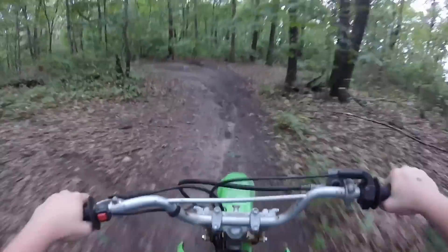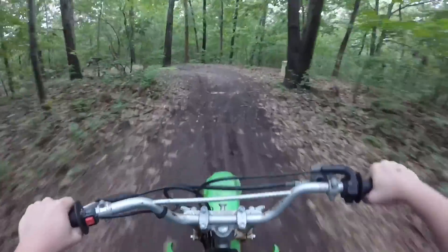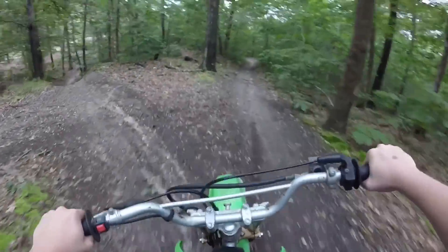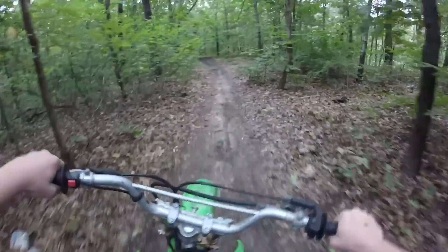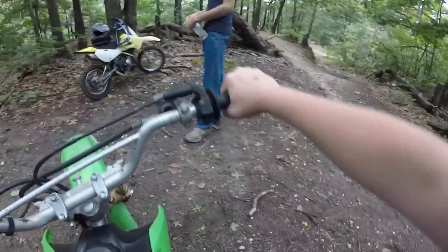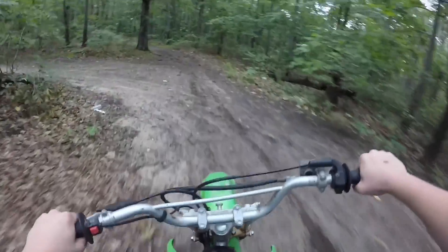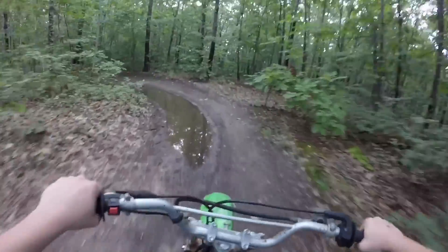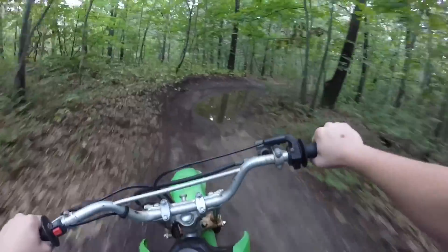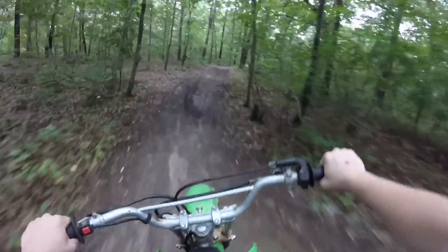These little puddles actually help you get up above the banks, which helps me out a lot since I'm not the best rider. If you guys don't know, this is a 2006 Kawasaki KLX 125 - one of the newest bikes added to the squad. This thing has a bogging issue when you go full throttle - it bogs down. Maybe riding it a little and getting it back up and going might fix it, because this thing was sitting for years outside. I did clean the carb and everything and it is spotless, but the carb might just need to be tuned.